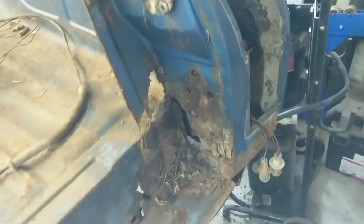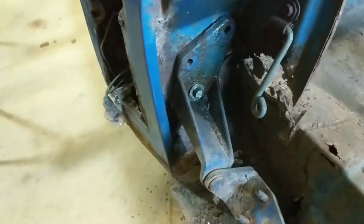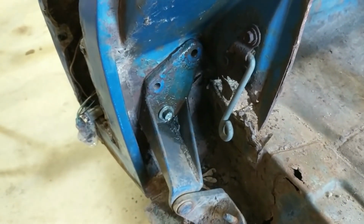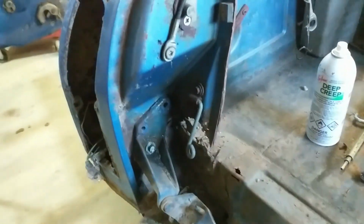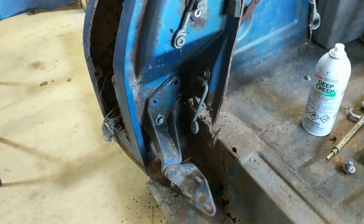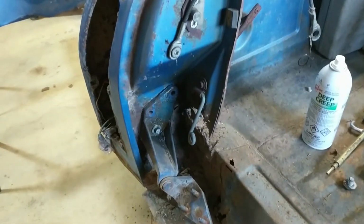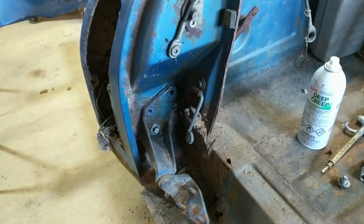Well, that side's off. Okay, so I'm down to the one last bolt there. I'm going to heat it up. Heating one bolt's not so bad. The other one came out nice. I went to the impact because I can control it a little better, set it on half percussion, and it seems to work better. Though I don't like to do it unless I've already started the bolt. So this bolt I haven't been able to start, so it's in there pretty tight. So I'll put some heat on it and we'll get back to you.